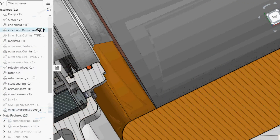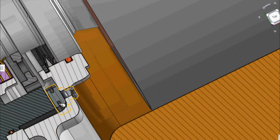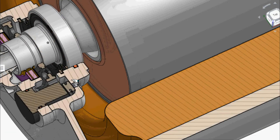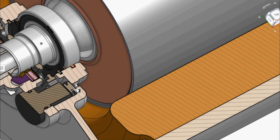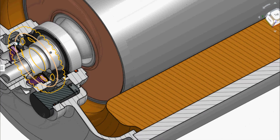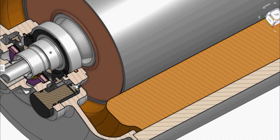There's just enough space behind the speed sensor — exactly the same as the breather the inverter already has. This results in a larger pressure drop across this vent, increasing the chance of breathing through the bearing. However, I deem the pressure drop negligible as long as the membrane here does not get clogged. This is a compromise between leak tightness and bearing life. Maybe just closing the hole would be fine too. The reluctor wheel may also act as an air pump, creating a circulating flow, sucking air in through the bearing and pushing it back out through the original hole. Mind you, at 65 miles per hour it rotates over 7000 RPM, so removing the hole and putting a membrane breather instead may reduce this effect — but this is speculation.